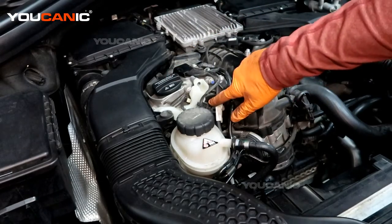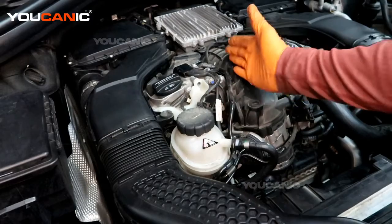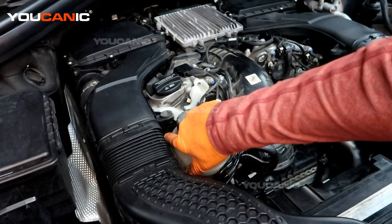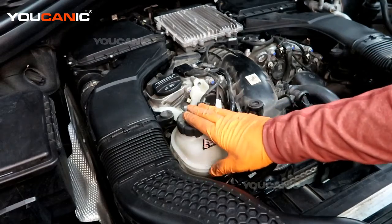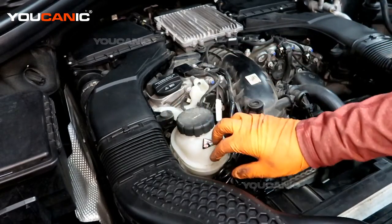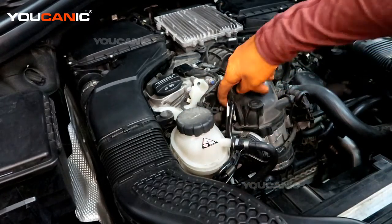Our bank one actuator for the intake is the one closest to the intake, of course. The one close to the exhaust is your exhaust actuator. We're going to go over the process of how you would get to those to be able to replace them. This side is a bit harder to replace, being that you have this coolant reservoir in the way and its bracket.